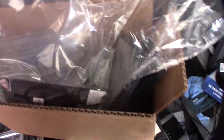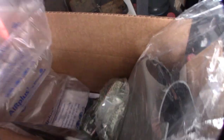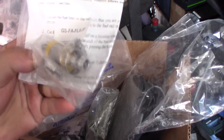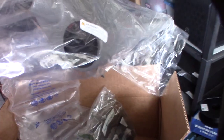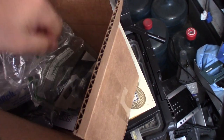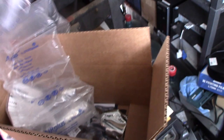I got some pressure sensors too because I want to hook up my coolant pressure gauge. Instead of having a manual gauge like I have in the cab right now, I wanted to connect it to the analog input on the Bully Dog. I bought this from Glow Shift — it's gonna allow me to tap into my coolant line and hook up a sensor. I got a 30 psi sensor and also a gauge mount.